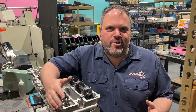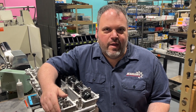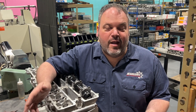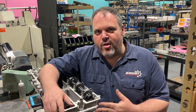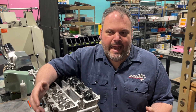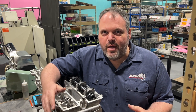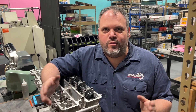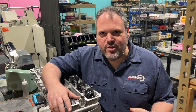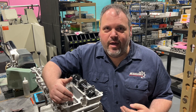Bench lash and lashing on your engine is obviously different — you won't have all the same equipment, and we don't have all the variables you might have with engine blocks and so on. So we set it on the bench, you go put it on your car, check lash, and you'll find it's either way off or spot on. Most of the time it's really close and within our range, so do you need to change it? No. Does it need to match the cam card exactly? No — it needs to match our specs.